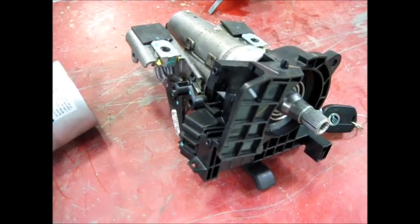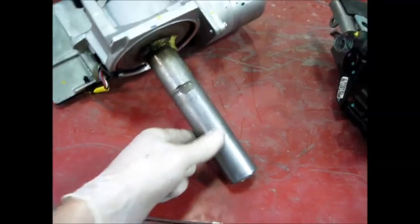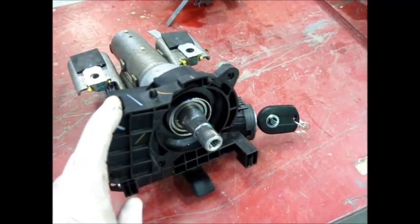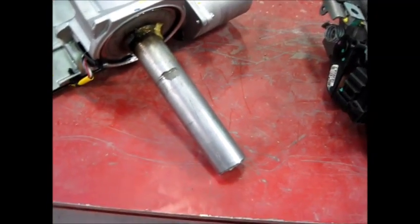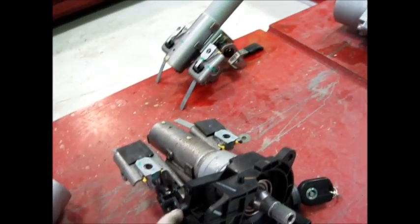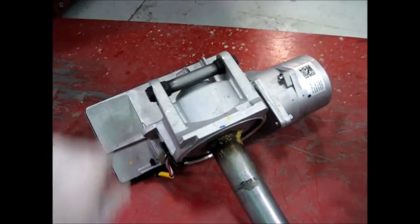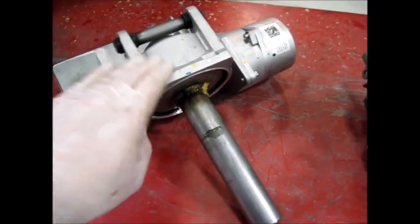What that allows us to do is just take this piece, because when you get the new part from Ford it's going to contain the whole entire column rather than just the assembly with the motor. You can pull this apart so you don't have to disassemble it any further, and take this piece to put on your new motor. As you pull this apart, you unbolt this portion first, the column drops down, you slide it out, and then undo the bolt up here that the motor assembly pivots on. Pulling this out of the way makes it much easier to get this piece out.